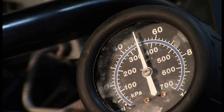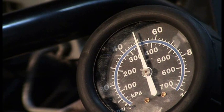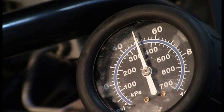Number five - if anything it might be just a hair higher in pressure, which would mean it had a little bit less fuel delivery. But the trouble is we're talking about well under half a psi - just an insignificant difference - and that is not going to explain that much of a fuel trim.